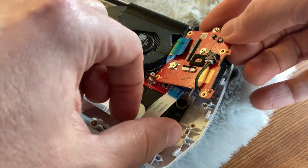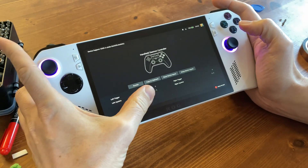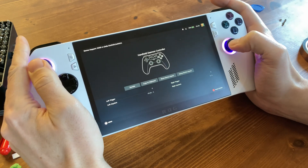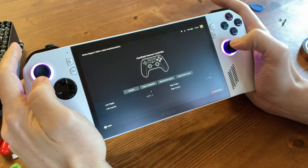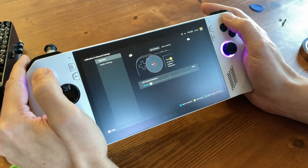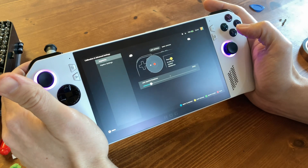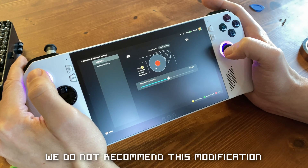Once everything is put back together, we can say it does work — but if you check the bottom value, it is off-center, slightly pulling left. Another thing we noticed is when you push R3, it gets detected as pushing right on the D-pad. Outside that, all other buttons seem to work. But using the L2 trigger still affects the left analog stick, and there's not much that can be done to fix this other than use a technology that isn't dependent on magnets. We could raise the deadzone settings, but having it anywhere above 5–10% will make any stick feel inaccurate. So in our opinion, hall effect sticks on an original ROG Ally isn't really worth doing — we restored our sticks back to stock.